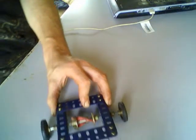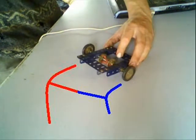When a car drives in a straight line, both wheels on the axle turn at the same speed, and so the axle itself turns at the same speed. However, when the car turns a corner, the outside wheel travels a greater distance than the inner wheel in the same time, so it must be rotating faster.